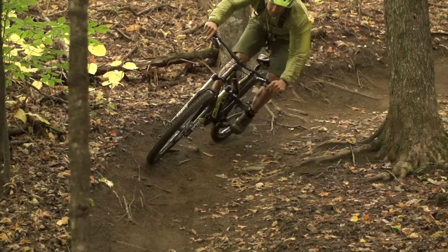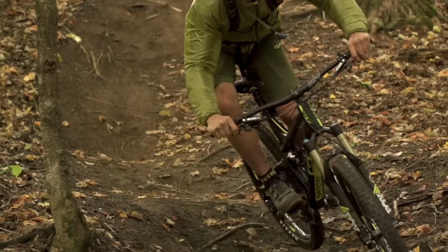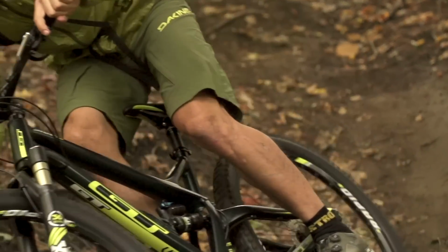So the whole idea with the iDrive is generally to try and limit chain growth. Right? Yeah. And this one does it, I would almost say conservatively. I took the shock out and cycled the rear end and looked at what happened, and you didn't see that bottom bracket moving 20-25% as far as the rear end would. It stayed relatively planted, and that made it still plenty supple on the downhills, but the thing didn't climb bad. I mean, no, it doesn't climb bad.